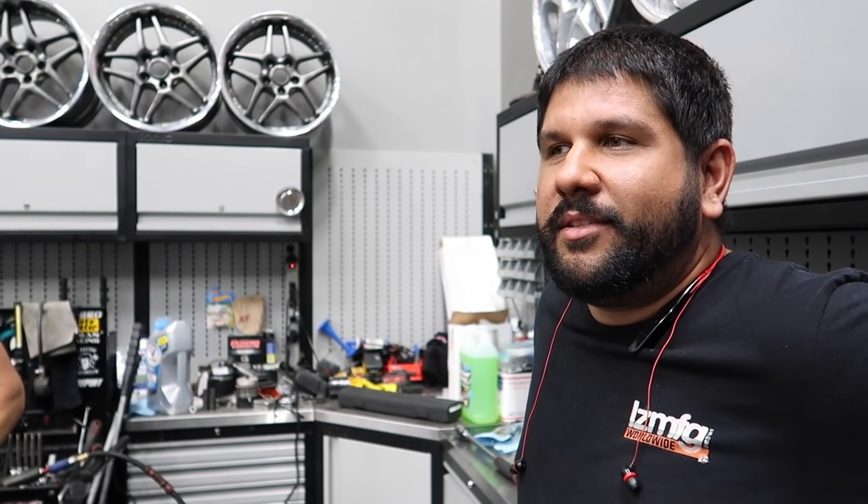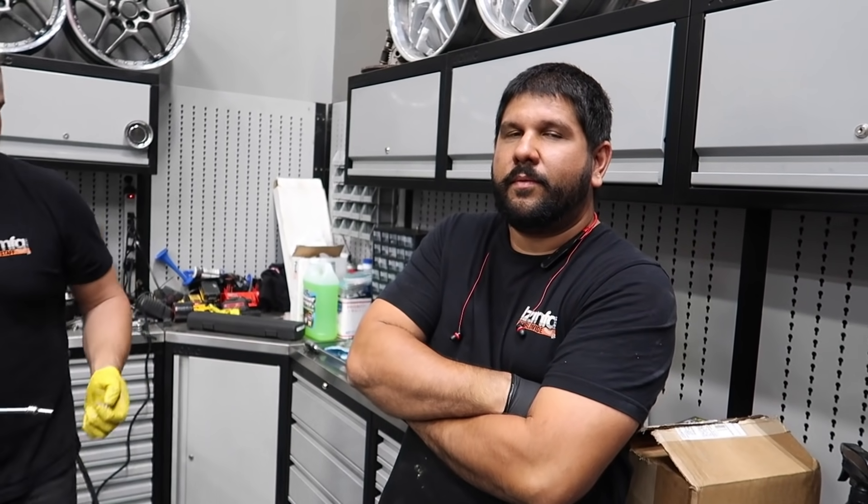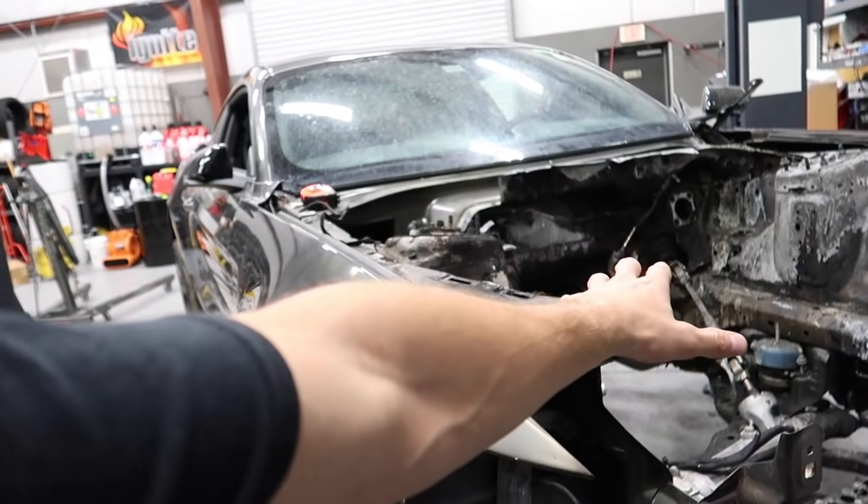The only thing this chassis would be good for is a drift car with a plug-and-play standalone, no integration, just ignition and go. Here's another big thing - the transmission plan is a 6R80. It's an automatic that came in some Mustangs, but I'm getting one from an F-150. It's a six-speed, paddle-shifted, trans-brake-capable, standalone-controlled automatic that can hold about 850 wheel reliably, or built can handle about 1,500. Putting down 1,200 horsepower on a stick shift is going to be very difficult.